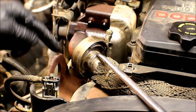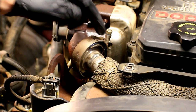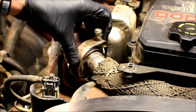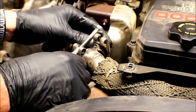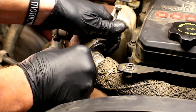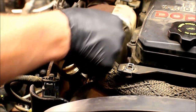This portion is coming up, but if this side was stuck you'd have to pop it loose. There are three sections that create that circle — they need to be broke loose. Once they're broke loose you can rotate it around, squeeze in on the clamp, open it up by spreading it apart, and rotate it around until you can clear the pipe.